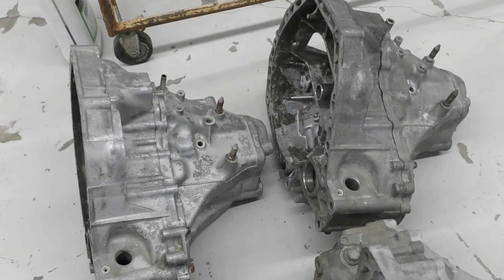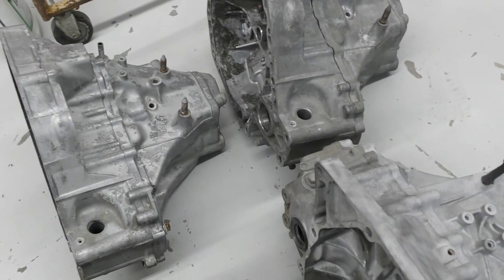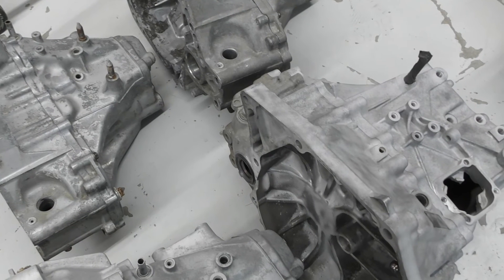The yes side is that you can vapor blast a complete engine. However, we do not recommend it. If you vapor blast an engine, the high-pressure water and media will actually get inside the motor itself. It can seep in through any type of passageway, lock up your oil cavities, and affect the gearing to where it will eventually break down and create irreparable damage to the components. I would not recommend it in any way, shape, or form.